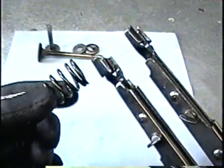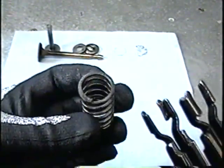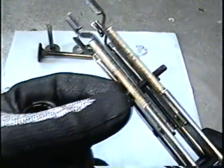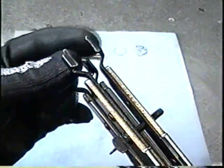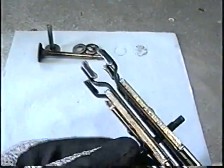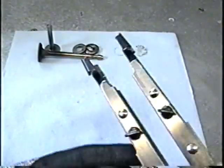Here are a few features of this tool. When you take apart an engine, you're going to notice that some of the springs are bigger than others, and that's why on this tool, if you loosen this screw here, it widens the gap for the spring. So if your spring is smaller, you would just screw it in — you can see it's closing in there. And there's one of these adjustments for each side of the tool.